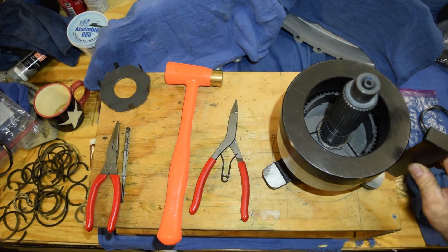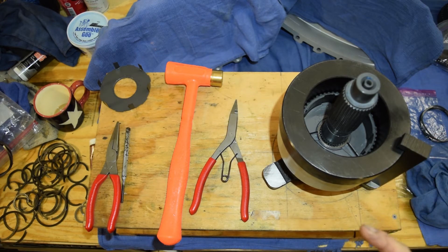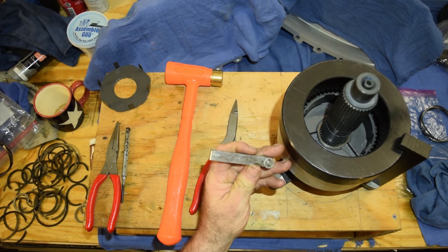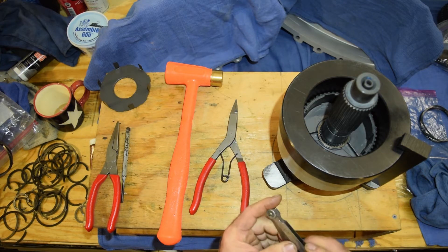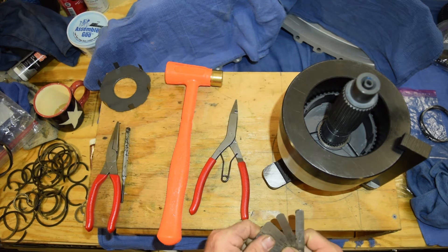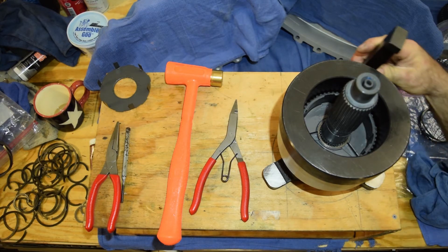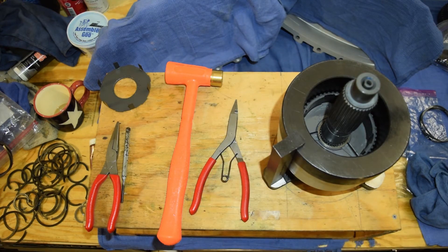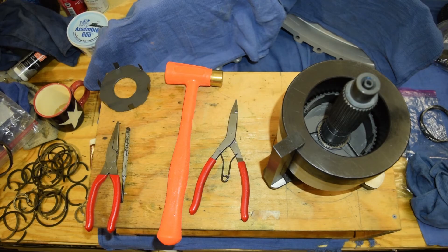We have this bar that sits right like so, and then you measure — you get your feeler gauge. This is one I've had for many years, it's a Cal-Van, made in the United States. I call it an abbreviated feeler gauge; it doesn't have all the micro sizes. You measure in three places and then you average it out, and whatever number you come up with is what your shim size needs to be.